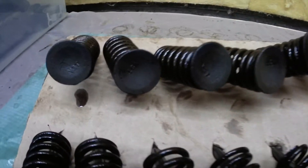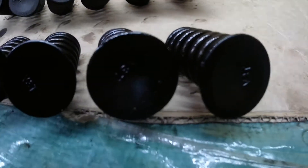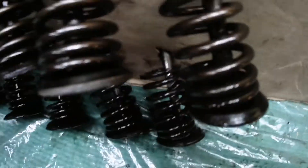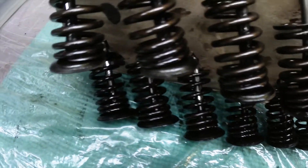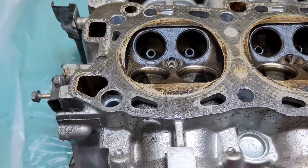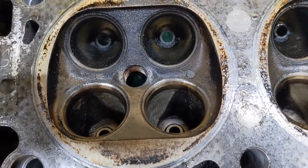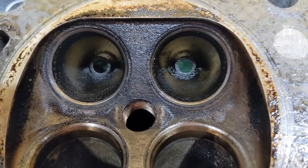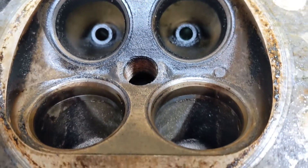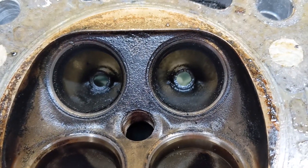Now with all of the valves out, let's take a look at how the valves from the reverse side look. There's definitely less carbon buildup on the intake side and the exhaust side looks to be about the same. That being said, they're all very black and very dirty so I really do think I'm going to go ahead and replace all of these. Taking a look at the bottom of the head, again you can see just a lot of buildup and carbon. These are going to need to be really well cleaned and I need to look into possibly getting them refinished. I've seen some people clean up that edge so it's nice and seals well. So we need to see whether it's something I can do or whether I'll need to send it to a machine shop.